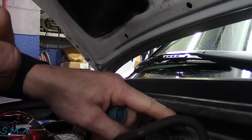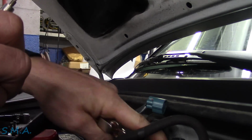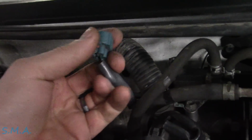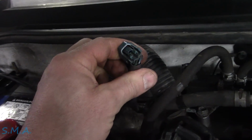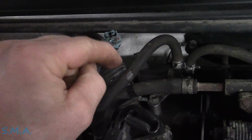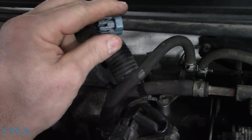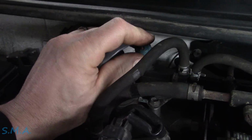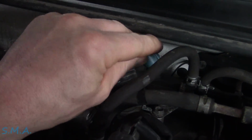So that's good. Now I have already checked this Purge solenoid to make sure it is not shorted, and as a precaution he got a different one to put on there in case it was intermittently shorting. You know what I'm saying? Because once you find a circuit that's bad, let's say this thing's burned up the transistor, whatever's in the PCM that switches it on, that gives you a little pause. You're like, well, what smoked it? Was it this Purge solenoid shorting out and causing an overcurrent on that circuit? And the original one tested the same as the replacement. I think it was 30 some ohms, so it doesn't draw a ton of current.